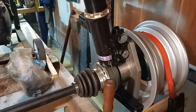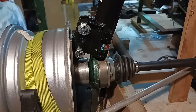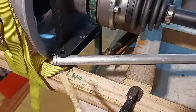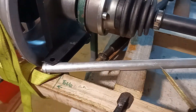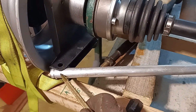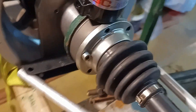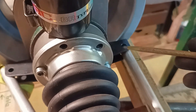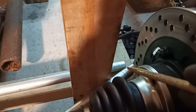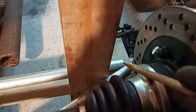I'm quite pleased with how they turned out. The strut bolts in and is canted over at 75 degrees. These two aluminium tubes indicate where the control arms attach at the bottom — what I call the toe control arm there, and the camber control arm there — both coming back to what is a reverse wishbone arrangement, with their inner mounts together at that point just in front of the brake.